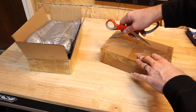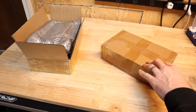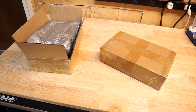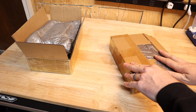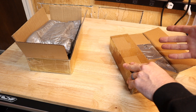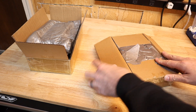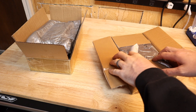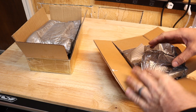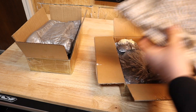Let's get it open up - I'll show what is going on with everything and we'll get the rear subframe dropped out of this car. You do have to weld these on. I've seen people glue them - I don't know how much I agree with gluing. I mean, I guess it's better than nothing, but preferably you'd weld them. You do not have to do a 360-degree weld - you can tack weld it all up there and just get it so it's not going to move. That's what worries me about glue: if it's flexing at all, that glue could crack. Even just a few tack welds is probably better than glue.